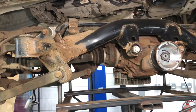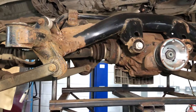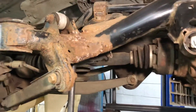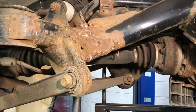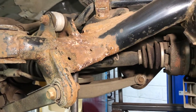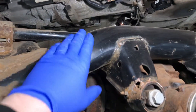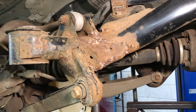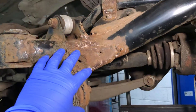We do this because we have to refurbish cars and undersides quite regularly, especially the E90, E92, E93 M3s. Lots of owners are contacting us seeing that they've got lots of corrosion on their subframes, which really isn't nice when the outside of the car is so stunning. Then you look underneath and see all this corrosion building up, which is quite a concern — especially when it should have looked like from factory: a solid, nice black coated component. But the paint just flakes off or the exhaust heat burns the paint off, and then corrosion sets in over the years.